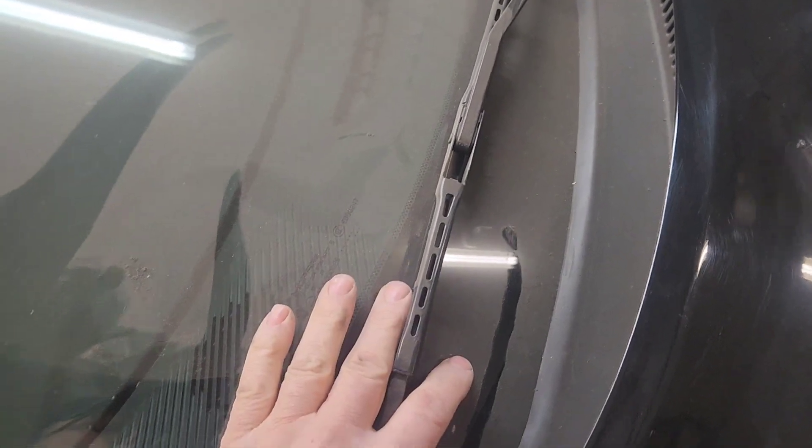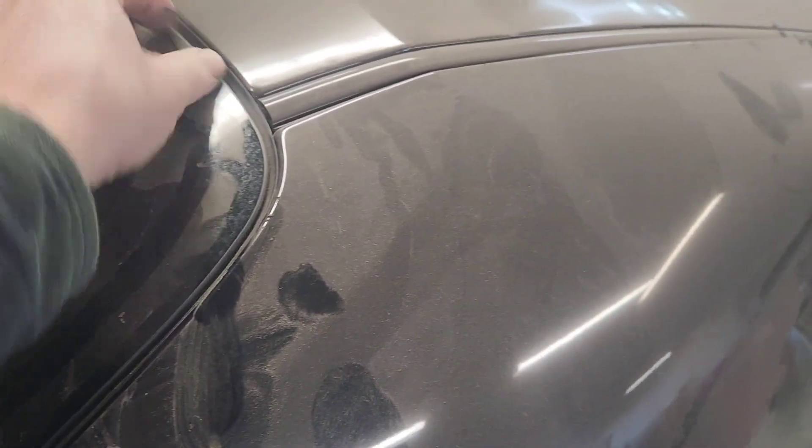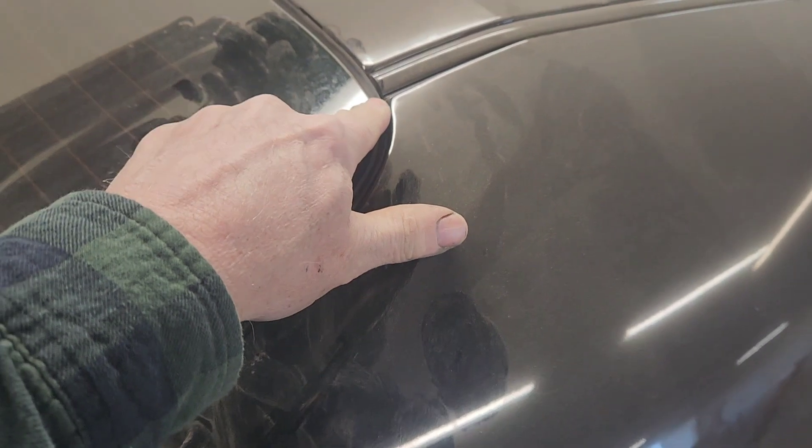Under here there are just some quarter inch spacers and the rest relies on a bed of urethane. The rear glass is done the same way - it has this flexible little lip that rolls up into the bed. So I'll have to create my bed to accommodate this bead.